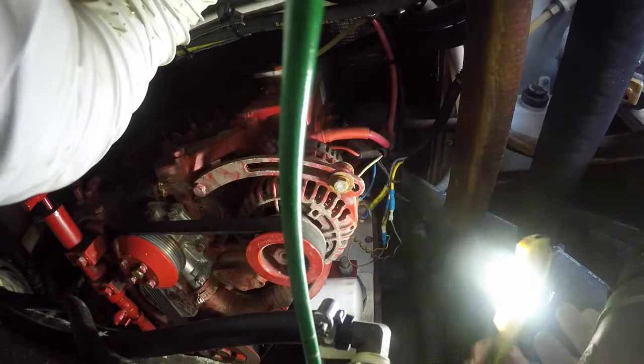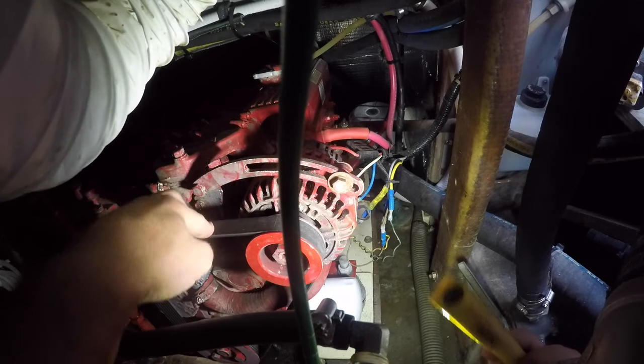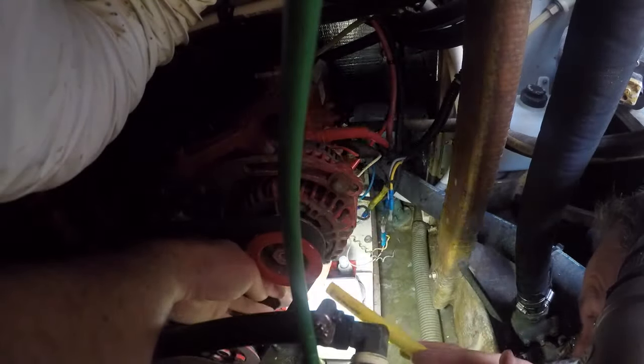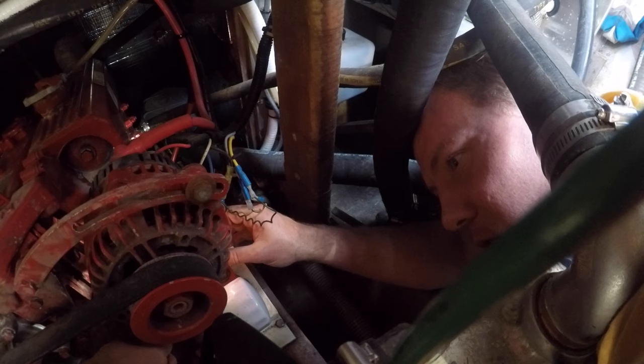All right, so there's the alternator. Here's the link adjuster bolt. All right, that's easy to find. If I push down here, that's quite a bit of play. But I can't find the support bolts. Bolt that I can see. Alright, you got time to try and hand me some tools? Sure. We're not doing anything up here. Bring the wrenches up and the spanners.